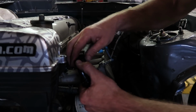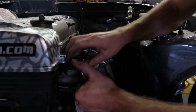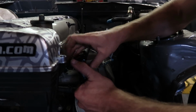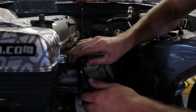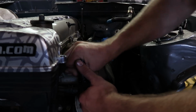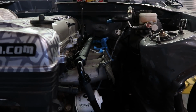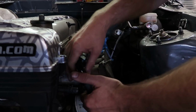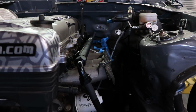This is a pretty large feed line, so it has horsepower in mind. If you guys are gonna do like 1,000 horsepower, I'm not, but you might be. You're set with this guy, you're not gonna run out of flow. And then you just have a -6 return, because the motor will use the rest of it, except at idle you'll have a lot of flow going back if you didn't stagger your pump. But I'm assuming you would stagger your pumps if you do it correctly.